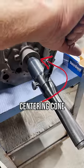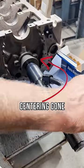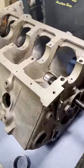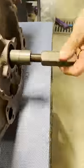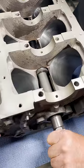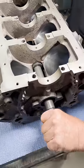Just like your traditional tools, a centering cone aligns the drawbar to the center of the cam tunnel. One at a time, the bearings slip over a fixed mandrel, and various different sized spacers are used to take up the slack between the mandrel and the nut. With the bearing pulled up snug and aligned, it just takes a few hand pumps and the bearing pulls right into place.